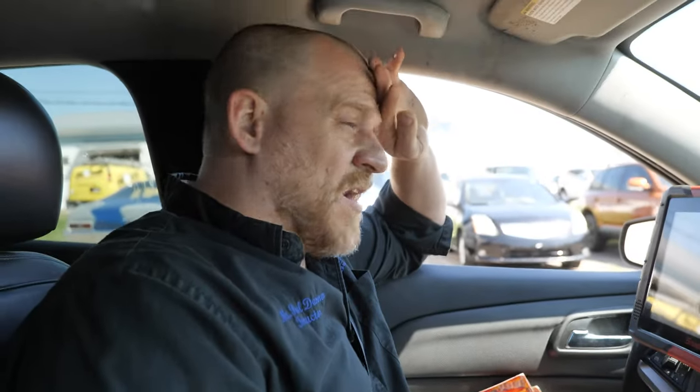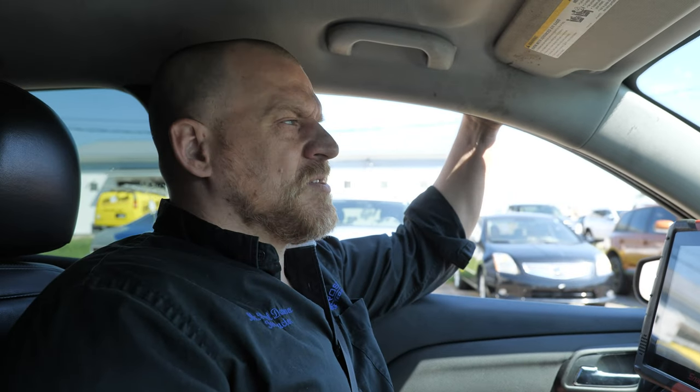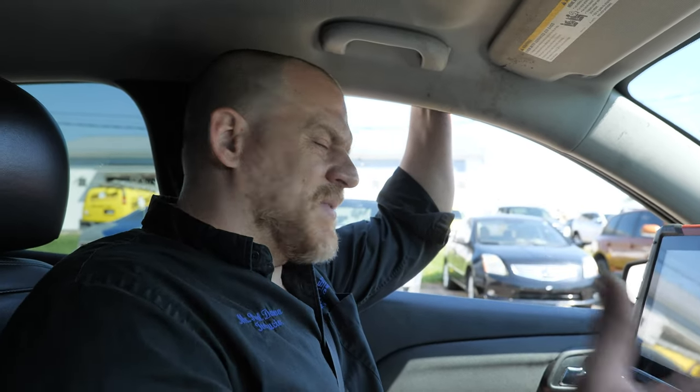All right. Danner and I were talking while I was taking this off the rack. What he had told me is they noticed the misfire codes yesterday, but they also were concerned, this is a GDI system, about maybe an injector, and they were looking at fuel rail pressure, and fuel rail pressure held. In fact, it climbed on shutdown, which is good. That's what you want on a hot engine. And he was checking that because they had some fuel rail pressure GDI related codes too, but this thing had codes everywhere. So that's the recap.